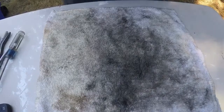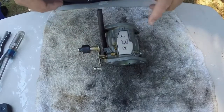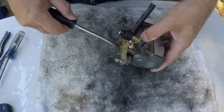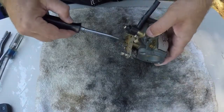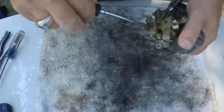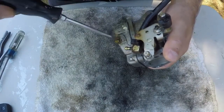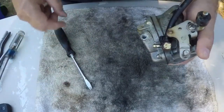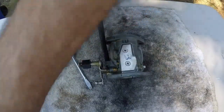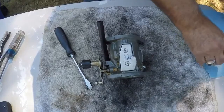All right, get out the middle one here. First off, we want to drain the gas out of the carburetor. There's a plug right there — use a slotted screwdriver, unscrew it, take it over and drain it. And a clean towel over here — we'll put all the parts that are coming out over here.